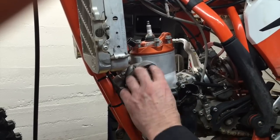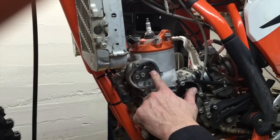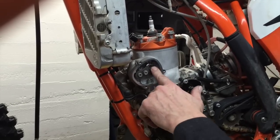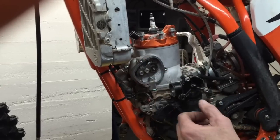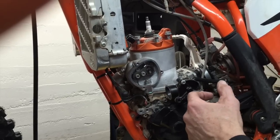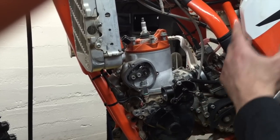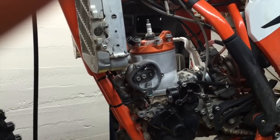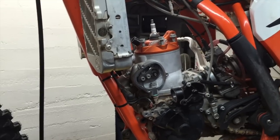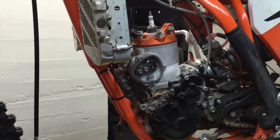And then you're going to want to put your covers back on. You should put some grease on these power valve gears. Just some light grease, doesn't take much, because it gets all that goo in there fairly quickly. That lubricates it. Hook your power valve linkage up on the other side. We've got a separate video on that. And obviously bolt everything back together, just backtrack.